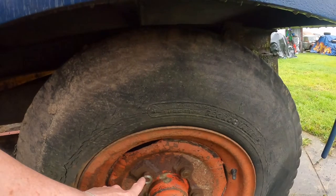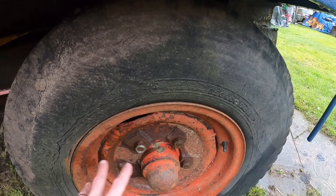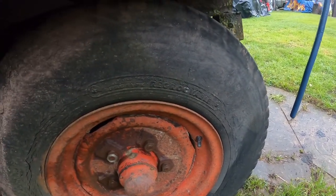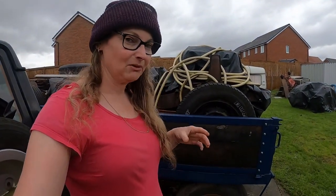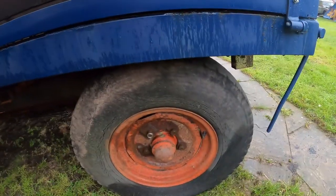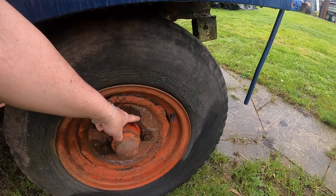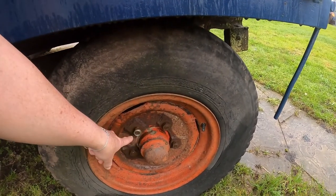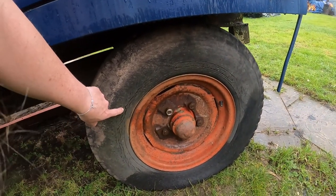What I've had to do is put a chamfer on these nuts, because unfortunately my worst fears came true when I looked at this job. What's happened is these tabs on here — they're not reinforcement tabs. At some point the wheels came loose and that's worn the stud, which I'll show you later. In preparation, I put a chamfer on the inside of these nuts. This was a double-edged nut originally with some weird ball-nose end on it, so I skimmed the face and put the chamfer on that one as well on the lathe.